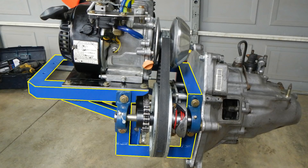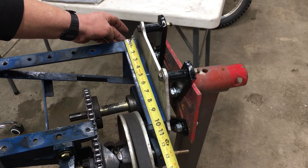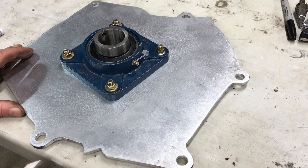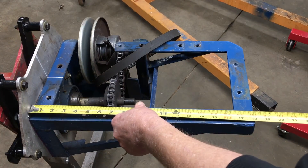Let's start today off by building the steel engine support cradle. For the most part, the new cradle will be a copy of the old one, but with several improvements. One of the critical parts we need to copy exactly is the upper bar that spans across the transmission adapter plate. This part sets the width of the cradle, and with the limited space we're working with, that's fairly important.